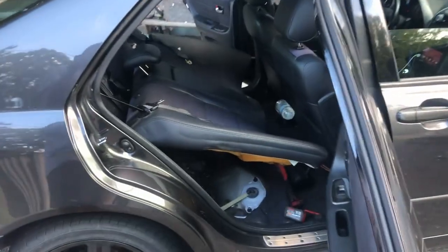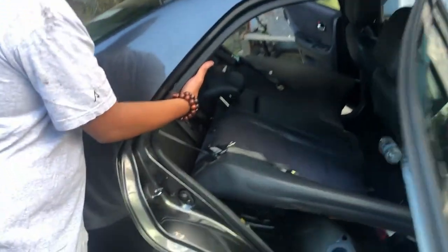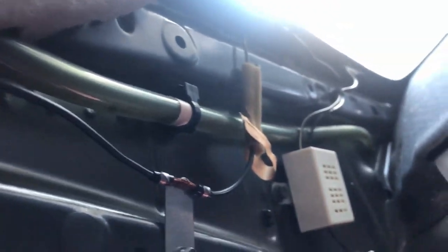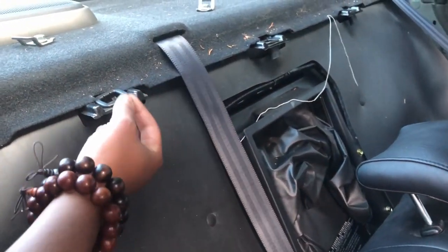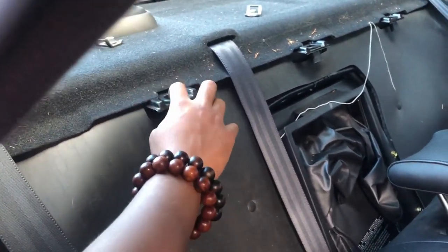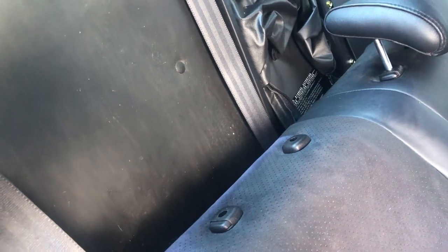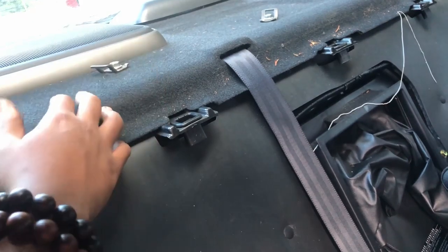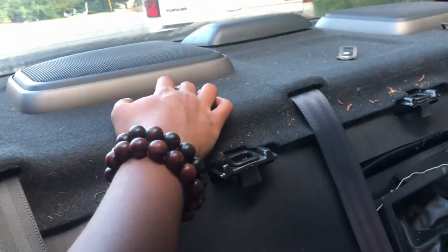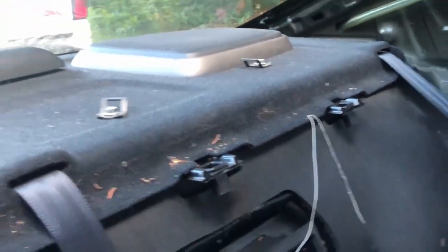We got the back seat out. If you're doing this and you have an IS300, the best way to do it is pull out these quarter panels — they're pretty easy to pull out with your hands, they're stuck by little pins. When you pull them out, there are hooks right here, like an L-shaped hook. There are three of them. After you pull these out, it makes it easier — you just push up and this should just come out really easy. After you do that, there are going to be clips on here, about three clips. You're going to have to pull the plastic off — make sure you don't break it.